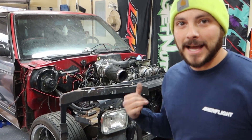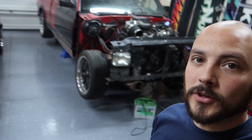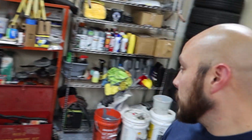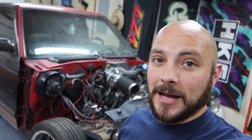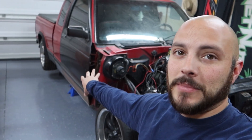It might be good to start putting on the front end. I think what was happening is I had the fuel tester still plugged in - it's got a relief valve - and where I had it placed it kept pushing that valve and relieving the pressure. We should be good now. It's idling, but I obviously still need to time it. It seems like it's searching for idle and might just be idling too low to catch itself. Alright, I removed the hoist, cleaned up the garage, toolbox is cleaned up, everything's put away. We're ready to start the next chapter - got a box of parts and we're going to start buttoning this up and make it look pretty. Thanks for watching guys, see you next time.